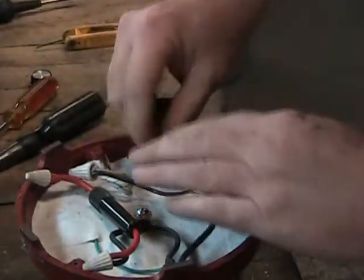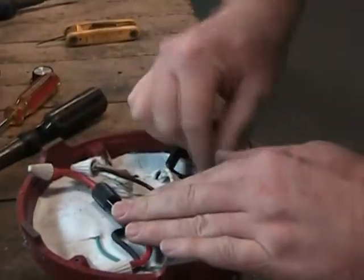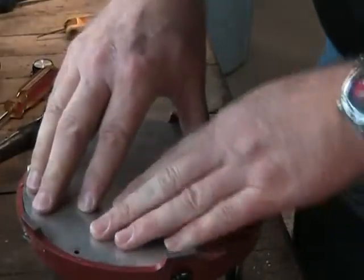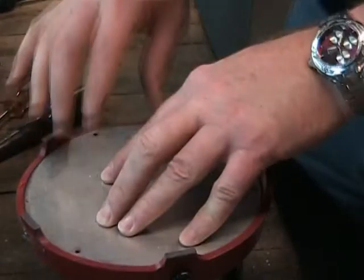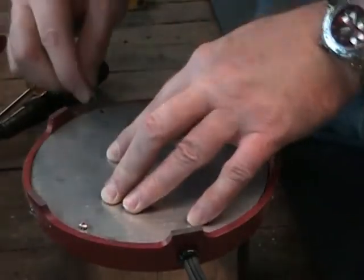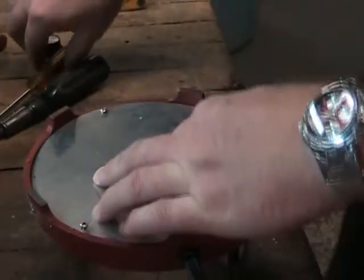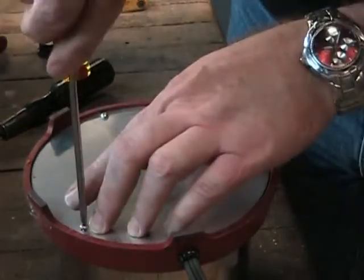Make sure there are no loose or stray wires and carefully reposition all of the wires flatly against the inside surface of the base. The base cover plate can now be reassembled to the base by first realigning the three holes in the cover plate with the three corresponding bosses in the base. With all of the wires properly secured beneath the base cover plate, we will replace the three small base cover plate retaining screws, tightening each of them down securely with our Phillips or crosshead style screwdriver.